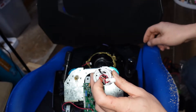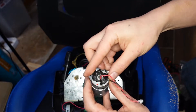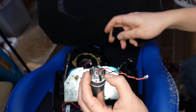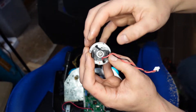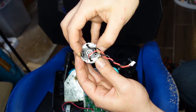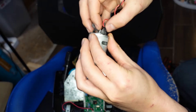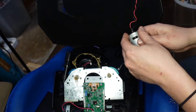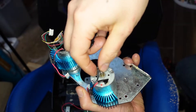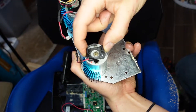This is the original motor, and this sits on top of it — you've got a cap, a rotor piece, and all that sticks together. But if you notice, I can get it right about there, the holes line up correctly, and it has this little embossment right here. On the newer replacement motor, that embossment is very much not the same and it kind of wiggles around.